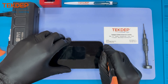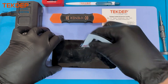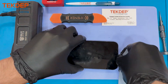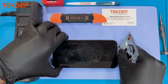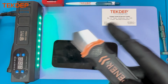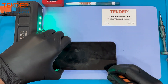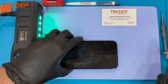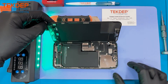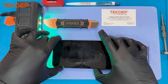I'll use an eye opener and poke a little bit around the corner to try to slightly lift the screen. Make sure you're lifting the screen with the frame, because the common mistake in this procedure is that the technician separates the glass from the frame. Those screens are very sensitive, so it's best to just poke around it, and there it goes — the screen lifts up like an open book. We're just gonna check that the screen still works after the teardown by turning it on — great.